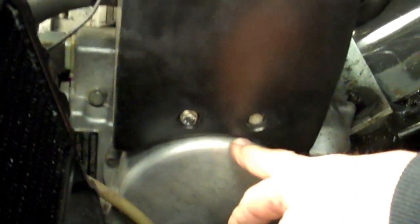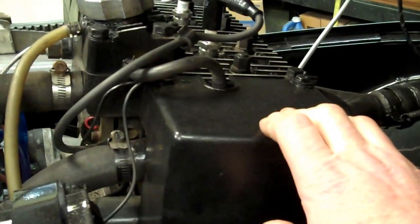Very nice muffler — no rust on that. The engine compartment was all painted and clean. While the engine was out I put new crank seals in it. It has a brand new CDI box on it. It wouldn't rev up, so I had to pull the engine out again and replace the stator because the high-speed coil was out — that's pretty common in these John Deere sleds. The pistons look just like new and it's got about 125-130 pounds of compression on each side, so fantastic compression.